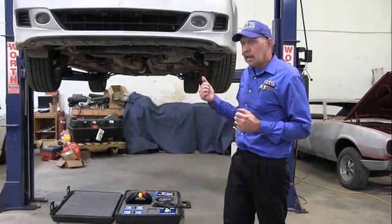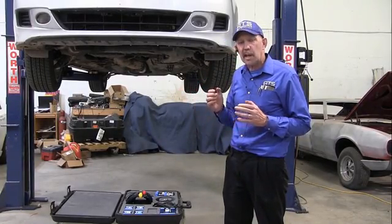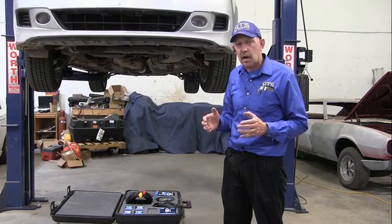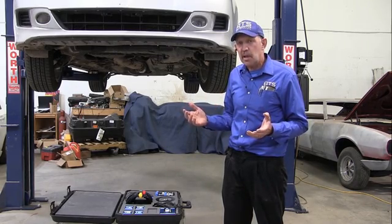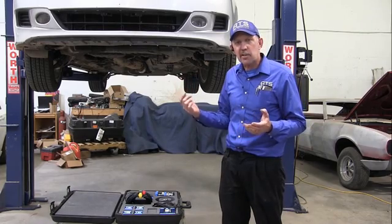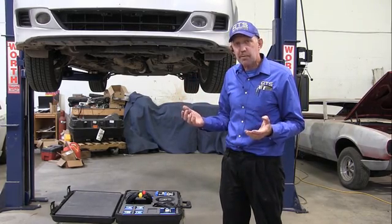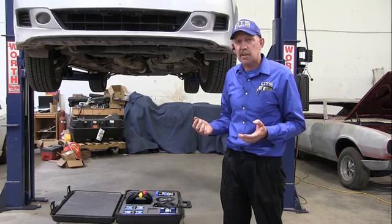Okay guys, I got a lift, so we're going to go ahead and get the sensors set up on this car so we can accurately diagnose this car. We can't continue to guess. We've already seen what guesses got. 4 tires, 2 axles, an axle stub, and the car still vibrates. And these are good shops that are working in a dealership that did this to this car.